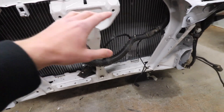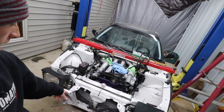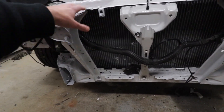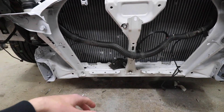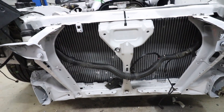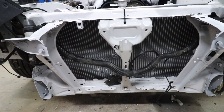I'll probably run a bar across here, then run a bar down from here and here. I think I can start mounting my intercooler to this even though this stuff is going to change — it won't really matter a whole lot because the intercooler will still be where it needs to be. I can go ahead and start making piping to it, and if this gets cut off I can just keep the intercooler where it's at with cardboard underneath it, then build a new bracket off the new tube structure.